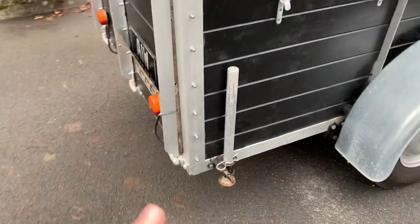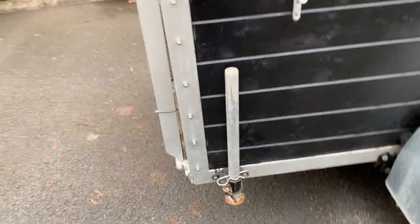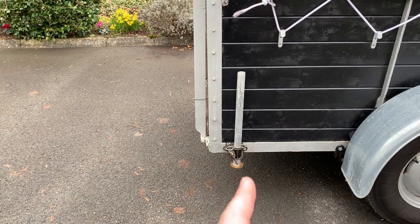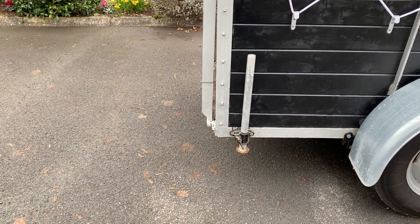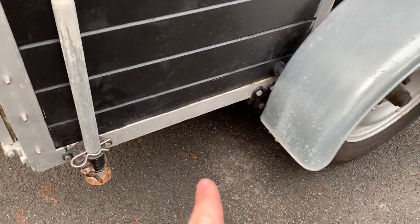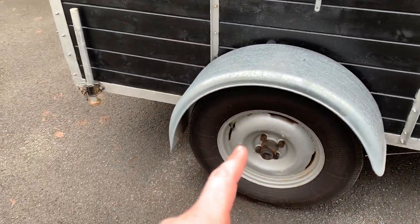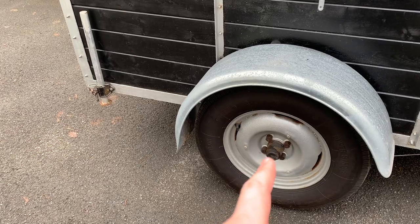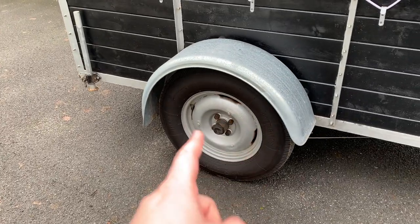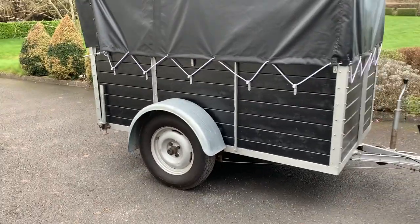Round here, again original stabiliser leg clamp. I've just put an R-clip through there to make sure the leg doesn't fall off or fall down while on the road. You have to remember these fittings are 1950s — 70 years old — so the threads are a little worn. Spring hangers are original, springs are original, they're absolutely fine, and the axle underneath is fine. I had the stub axles re-machined to take an M19 nut and new bearings were put in, but the hubs are the same. The wheels are original and I actually have the hub caps too, but they're not fitted at the minute because I took it to the beach last year and didn't want them getting rusty.